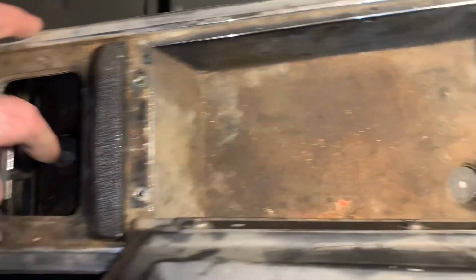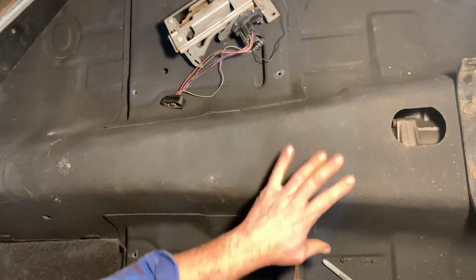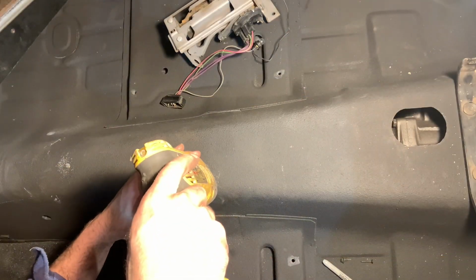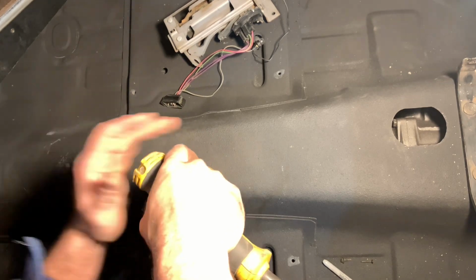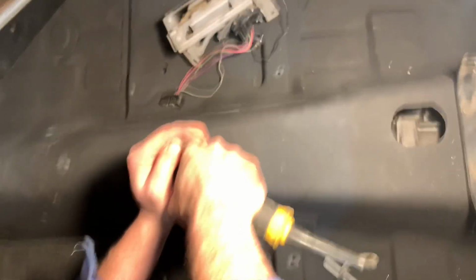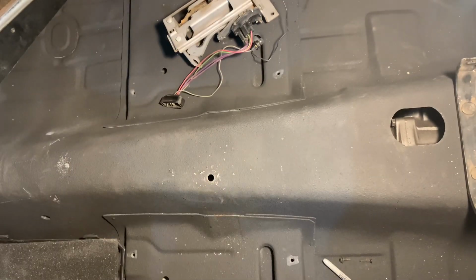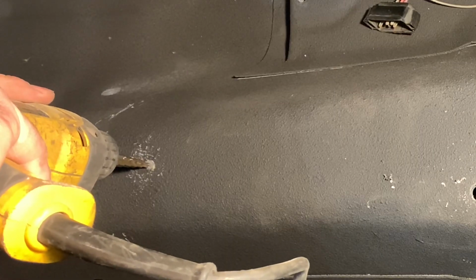So now I've got my floor marked. I want to punch the holes. So I'll go ahead and drill the holes here, and we'll get those thread certs installed. I've got the console pulled out of the way, so it makes a little room to get the drill in, but go ahead and use the step drill. I'm going to buzz right through this, hopefully. Again, now I got a nice, clean, half-inch hole. I'll do the same thing for back here.